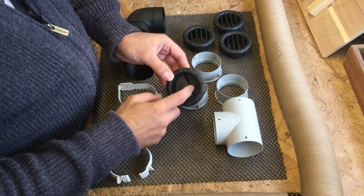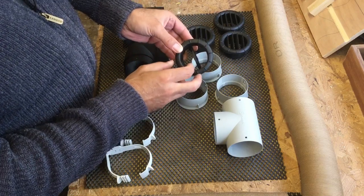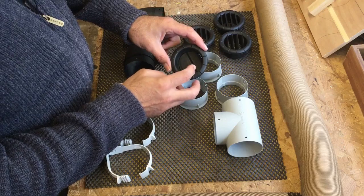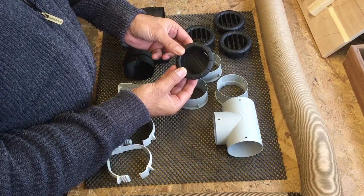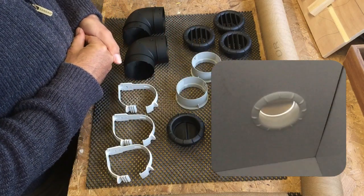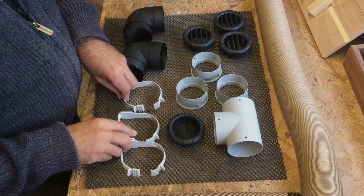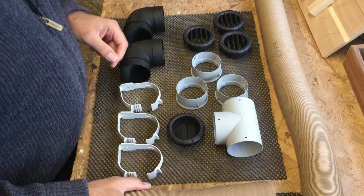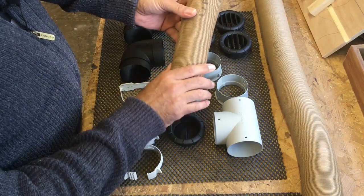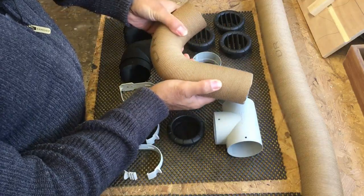There are some little outlets that have a damper in them so you can vary the volume of flow out of the heater. I'm going to use one of these particular vents in the shower cubicle because I want to be able to regulate the amount of heat going in there. They do them in different colours — I've got a white one to match the white PVC, and I'll show you that one already installed in the van. I've also got some 90-degree elbows and a selection of wall brackets. To distribute the warm air we're going to be using this flexible duct — it's foil-lined on the inside with a brown cardboard finish on the outside, and it's very flexible so we can mould it around all the different places in the van.